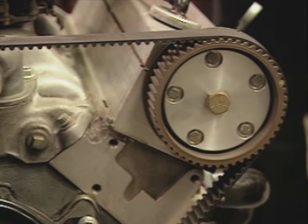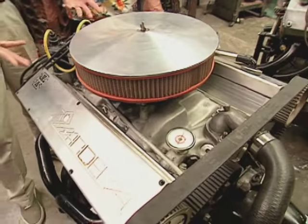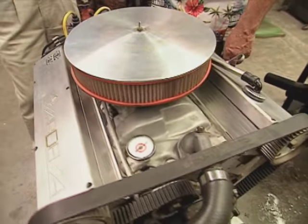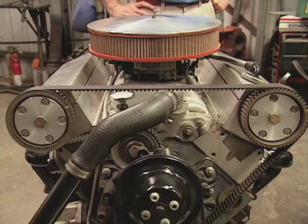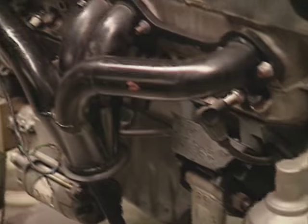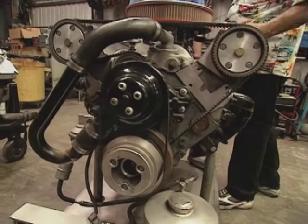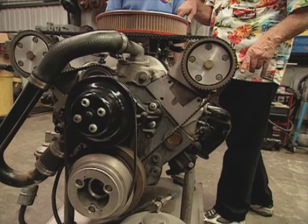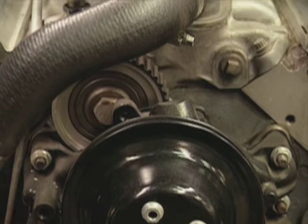All right. Now the original camshaft is still down in there. Right. But there's no push rods anymore. No. Push rods in the trash. And the cylinders they go through, the shafts they go through, what are they? The cam is still in there to turn the oil pump and the distributor. The push rods are gone. There's a whole oil line from the rear lifter hole up into the cam box for lubrication. Okay. All right. So you're at least using the passage.